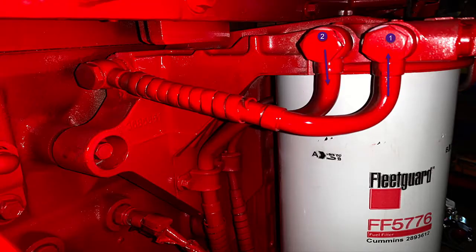The fuel leaves the gear pump and goes up through the ECM cooling plate to the filter. Remember, that is fuel filtered at 30 microns. Fitting number one is where fuel coming out of the ECM cooler plate goes into the engine-mounted fuel filter, and this filter will filter at four microns. Then it comes back out of fitting two and goes down to the high pressure pump.